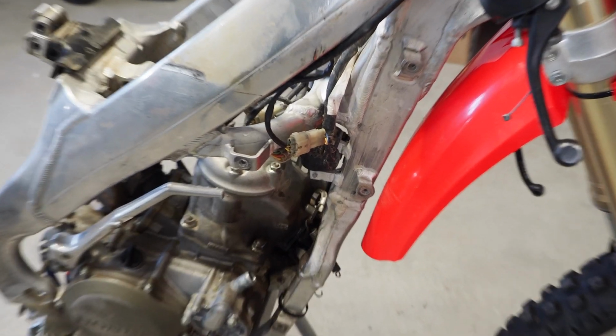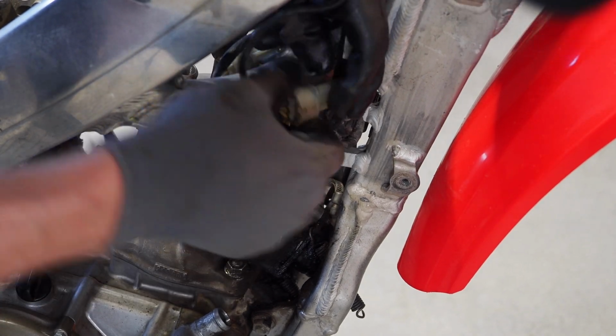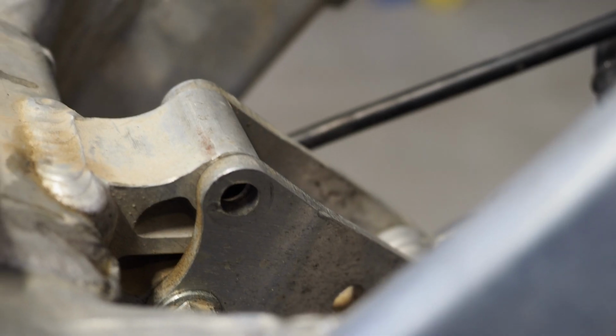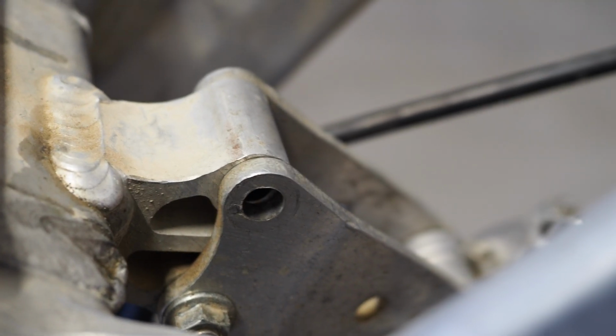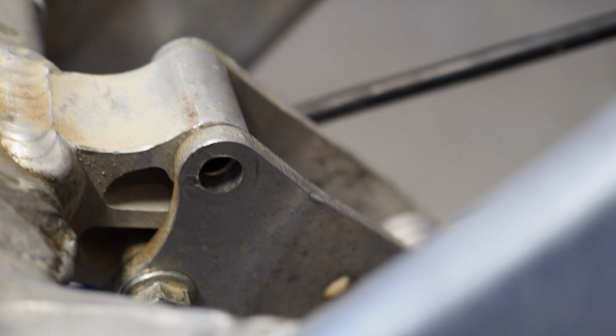All right, let's get this carb off now. There's a wire running off the carb right here that connects to the main harness. We'll go ahead and unclip that. Look what I noticed. We are missing a bolt to the top engine mounts there. I don't know if that's something CR owners do or if the bolt just fell out. If you CR owners know if that's a trick or not, leave a comment below. Otherwise, that bolt just straight up fell out.